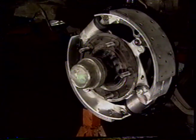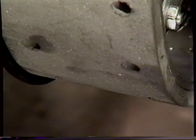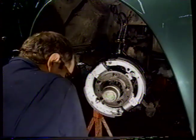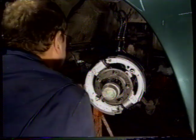Now we're going to true up the brake linings, or the brake shoes, I should say. You can see down through there the gap along that edge there is pretty even. And we'll try this one here. They're pretty good there. We could let the top one in just a little bit too. We're going to take a deep socket and we'll tighten up the lock nuts.